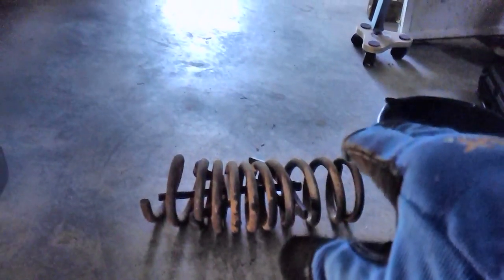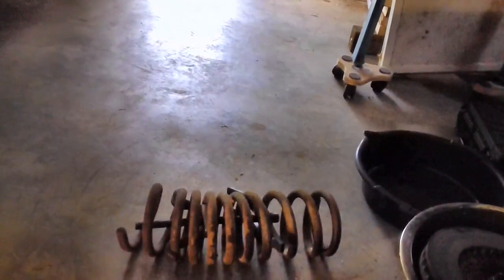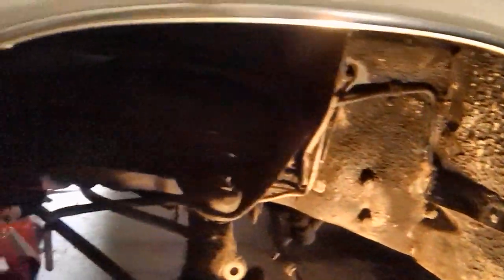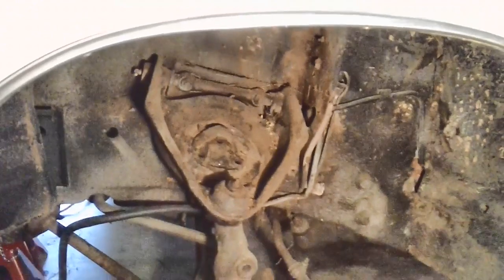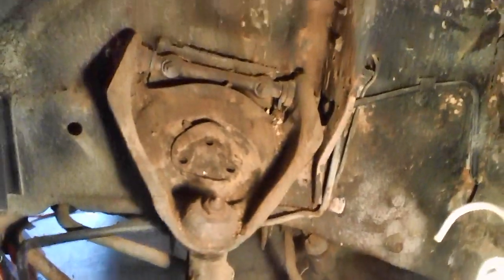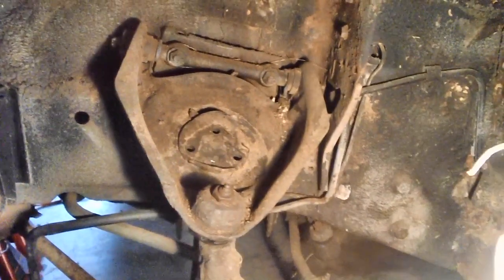To release the compressor I'll step on the spring with my feet and use a ratchet and extension to slowly loosen it — it'll gradually expand. I want a brand new set of coil springs on this car; end of story. I want it to ride better, steer well around corners, and be safe. This is a hobby car, not a NASCAR. We'll take things nice and slow and do it right. For those who've never done this before, I hope you're learning something.